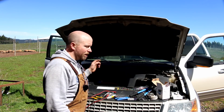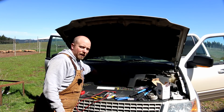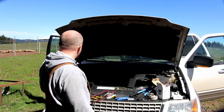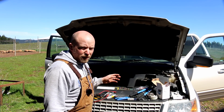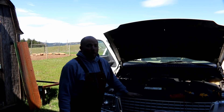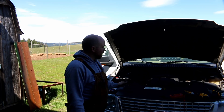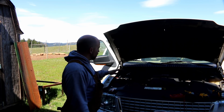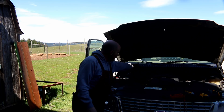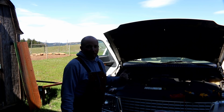Because it is a 500-amp relay, if it starts to detect current flow that's too high, it'll also open and stop the runaway from occurring. The relay is just sitting here right now and needs to be mounted on the firewall. I'm going to let this run for quite some time and keep an eye on the temperature and voltage of the back battery. I ended up moving the relay into the battery compartment where the cooler is. Positive, ground, alternator going to the battery as it should, and the accessory wire connected.